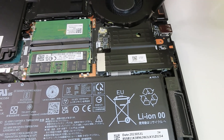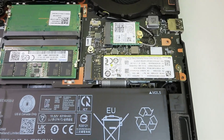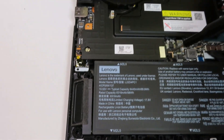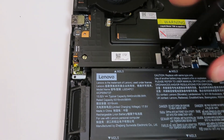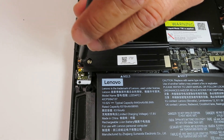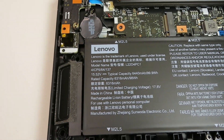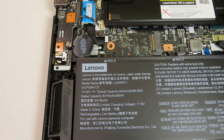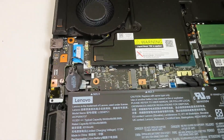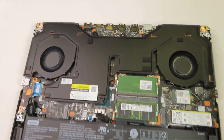Now I'm removing the caddy for the first SSD — here is the one terabyte SSD drive. The Wi-Fi card, as you can see, is removable, which is great — if it ever fails it's a very easy fix. Here is a second caddy for a secondary drive, which you can actually install yourself. On some versions it already comes pre-installed, but in this case it's not available — you can always upgrade though. Here is the CMOS battery, and as you can see pretty much all the external parts are on the motherboard except one on the right-hand side. That would be it for this one — peace and much love to everybody, see you in the next video!